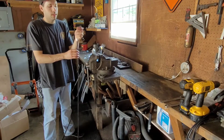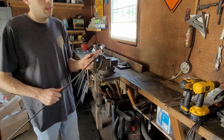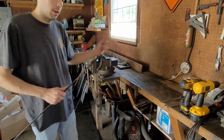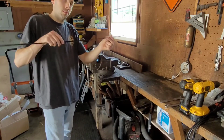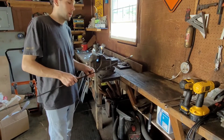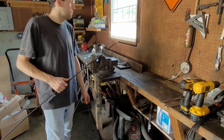You'll see what I'm talking about whenever I make this. Basically I just need to go underneath, and I have these long nuts here. I'm going to have two pieces of steel coming off with long slotted holes that will allow my second gear lever to continue movement without moving this rod, and then I'll still be able to pull it back and put my parking brake on. It'll all make sense whenever you see the finished product.